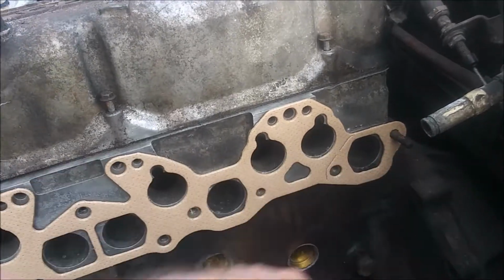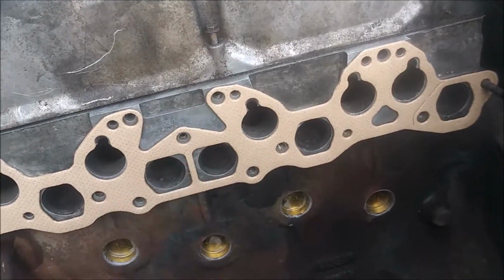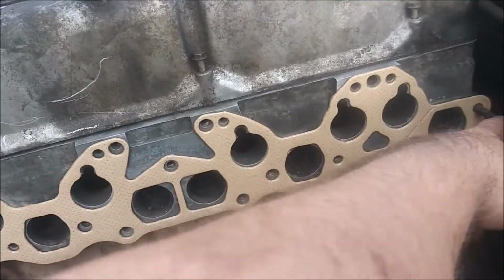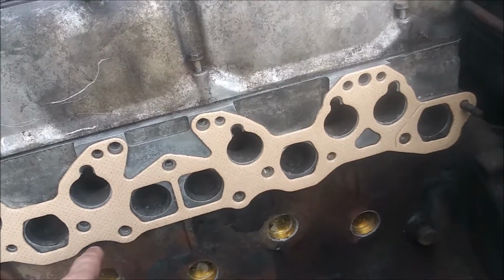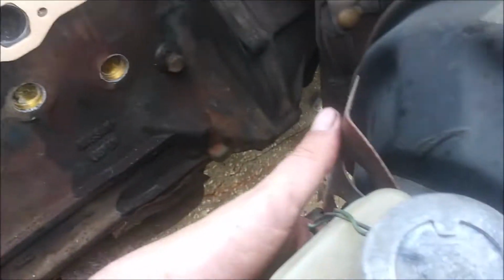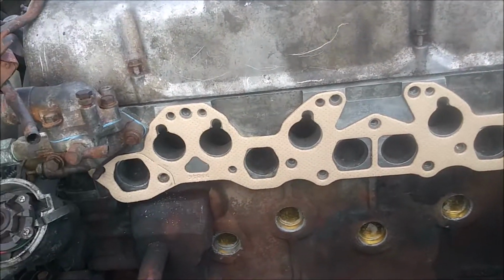And this one here, which is a regular bolt, since I was missing this bolt, I'm going to take the bolt that was here on the old head and move it to here. That way the middle is sealed, and later on I will go down to Ace Hardware or whatever and get 2 nuts. I've discovered when taking studs out of this head that the nut that holds the master cylinder onto the brake booster is the same thread pitch. So I'll just take that nut with me to Ace and get a couple nuts.